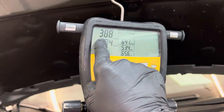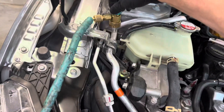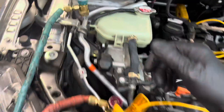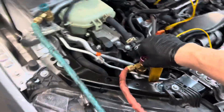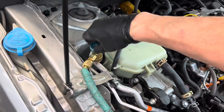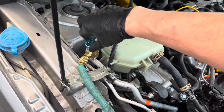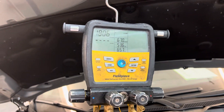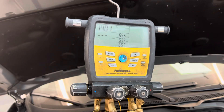I have a vacuum down to 380 microns right now. I do not have the fittings engaged — they are not screwed down yet. So now we're going to screw them down and see if this can pull a vacuum. Did my procedure work? It usually does, but not always. And we're at 26, 27 — we're into microns now.